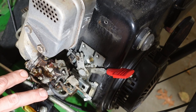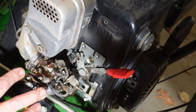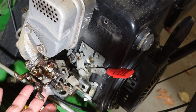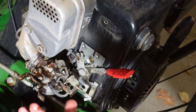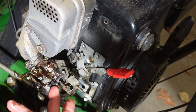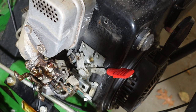I'd just like to leave this on for now because it most likely has nothing to do with the actual problem — it's probably got to do with the jet. If you've seen my last snowblower video, it's most likely going to be that the jet needs cleaning, that this hasn't been cleaned for a while. I will spray some carb cleaner into the throttle body and get some cleaning done, but I want to get this bowl off first. I went and shut off the gas at the tank — there's a fuel shutoff on this engine which is nice. Now let's find the right wrench and take off the bowl.